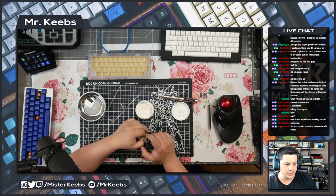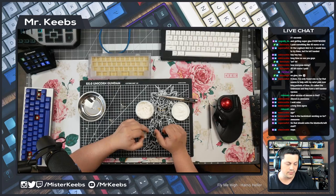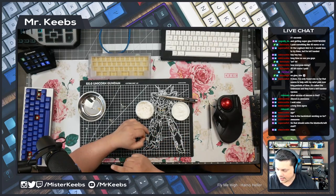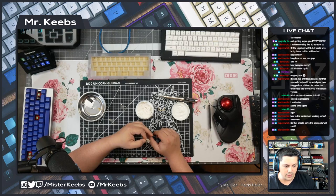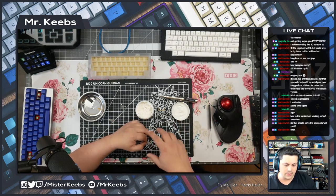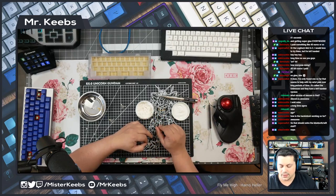Yes, that should solve the last piece of the puzzle, which is Bluetooth and Wi-Fi. So the problem was that apparently my RX 5700 XT doesn't work with PCIe 4. I was using it on PCIe 4 and the mouse would start stuttering, and then all of a sudden it would stop altogether and freeze.